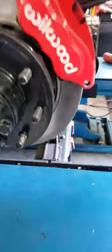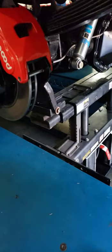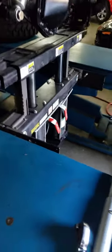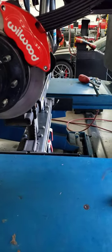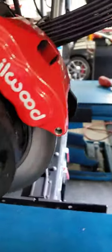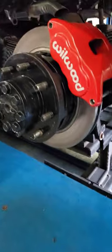Number four is a disc brake conversion for the rear. I put Wilwood D52 calipers all the way around on my truck. For once I had a little spare change, so I went ahead and built the braking system I really wanted. It fits inside my 16-inch wheels and might even clear a 15-inch wheel — I think it actually has more clearance than a stock caliper, though I don't have that as a verified fact. I also redid the entire brake line system with an adjustable proportioning valve. This thing stops ridiculous — it could probably put you through the windshield. Seriously, it's got some serious brakes.